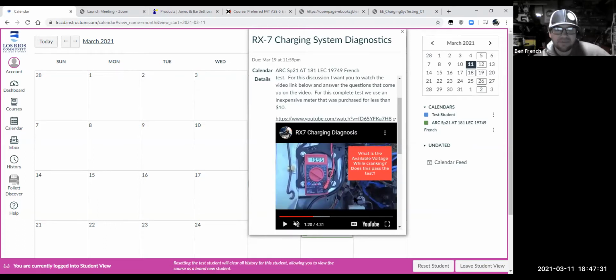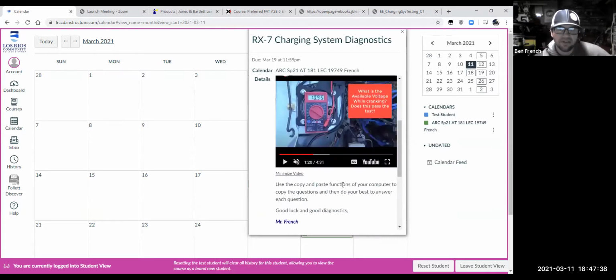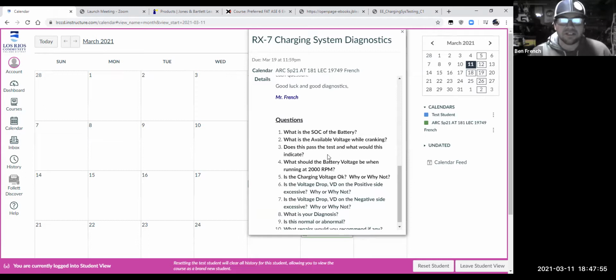Yep, 10.95. So then you ask yourself, okay, well, what was the state of charge? What was the available voltage while cranking? Oh, it was 10.95. Is that above 10.5? Yeah, it is. Does it sound like it was cranking over pretty good? I'll let you guys decide on that one, right? So you watch the video, the questions pop up on the video, but I also have the questions for you to answer right here. And you can just copy these questions and paste them with your responses there. So it's kind of fun.